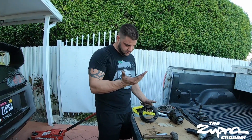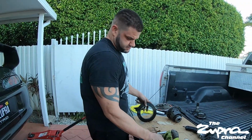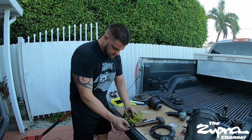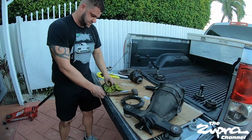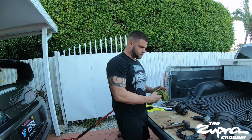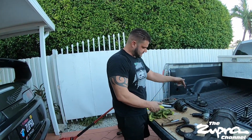You know, I honestly don't mind doing it every 4 or 5 years. I'm already used to it. I know how to do it. Just wanted to share with you guys, because I know I get diff questions every once in a while. But for anyone that's in the market to do a new diff, I wouldn't recommend this route. I would do an 8.8 with a Grannis kit. I only do it this way because I have this already.